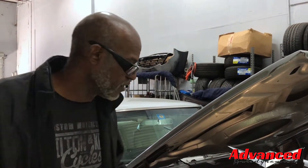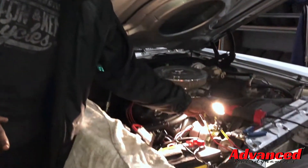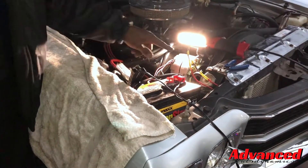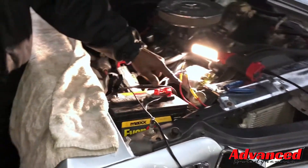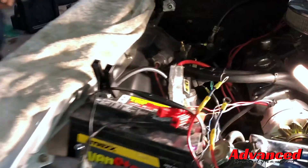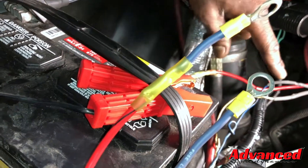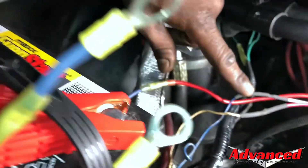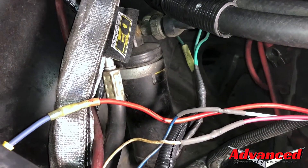I like soldering. However, when we added the fusible links to the connectors that will be connecting to the battery, I used a quick connector that also has heat shrink properties — that's because of the thickness of the gauge of the wire. On the thinner gauge wire, we actually soldered the joints in and then applied heat shrink as well.